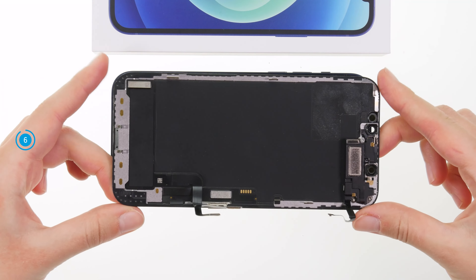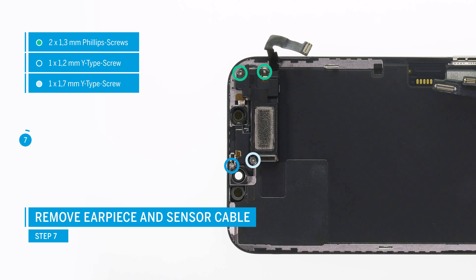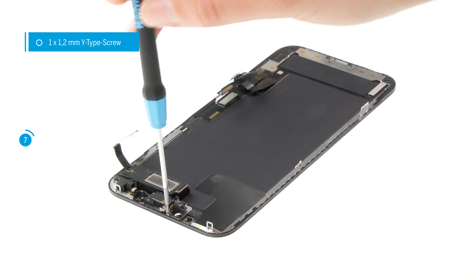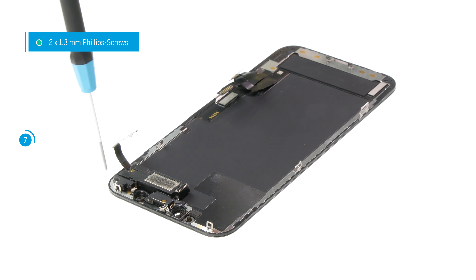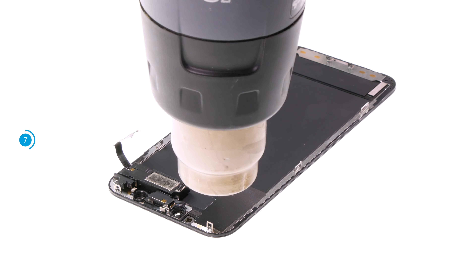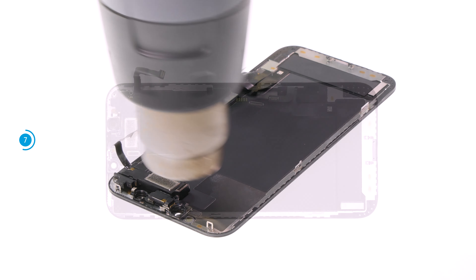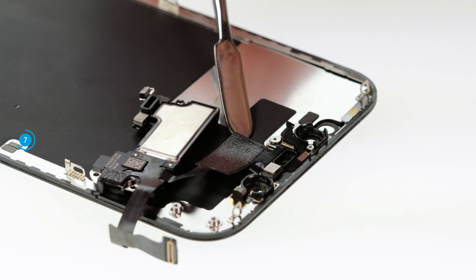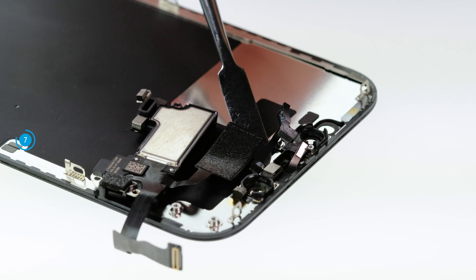You can then put the screen aside. Since the Face ID sensors are integrated in the earpiece, you have to take it over from your old screen to continue using this security feature. Apart from that, not every replacement screen has a pre-installed earpiece. To remove the earpiece including the sensor cable, you first have to loosen the two Phillips and two Y-type screws that secure the module. The sensor cable is glued — to make it easier to remove, you can run hot air over it. Then flip the earpiece over and carefully slide a steel spatula under the sensor cable to detach it from the screen unit. Use the steel spatula to release the sensors from the guides as well. Be especially careful not to damage the sensitive sensors.